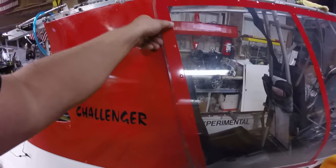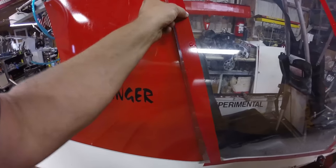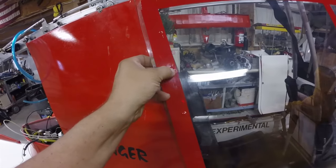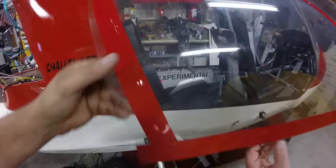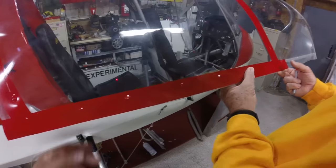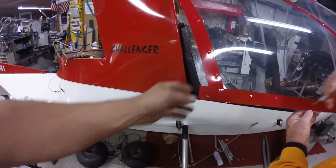When you put this tape on and there's an air bubble, just work those air bubbles to the rivets. Manipulate your finger around the rivet — when you put heat to it, it's going to tighten right up to that rivet. Push it up around like this, get them all nice and tight and snug, then trim off the edges.